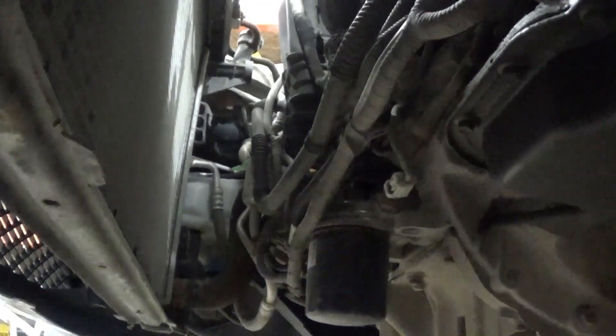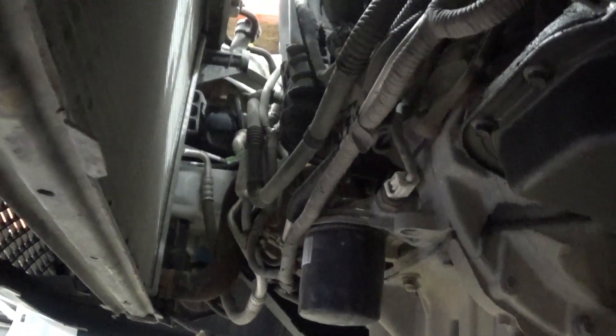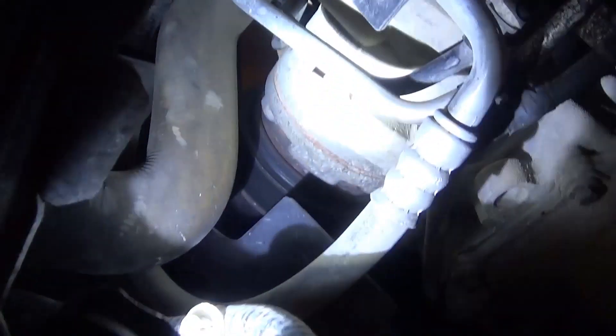After the cooling fan and the splash shield are out, you can see there's quite a bit more room between the radiator and the motor. I still can hardly show you guys on camera, but this is the lower radiator hose and it runs up over top of the AC compressor here. Where it terminates up here at the top is where your thermostat housing is, up on top of the compressor. Ford really did a number on this one, guys — it's buried up in here.